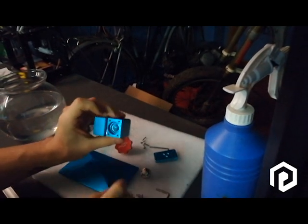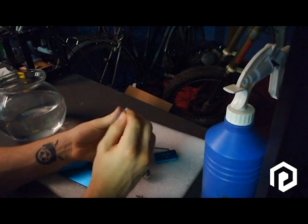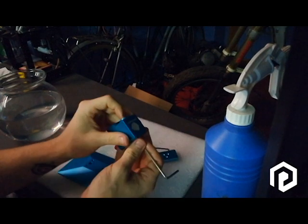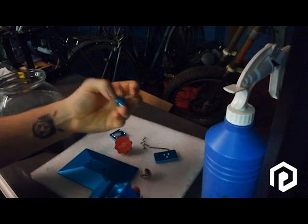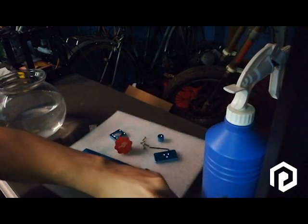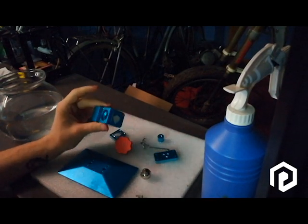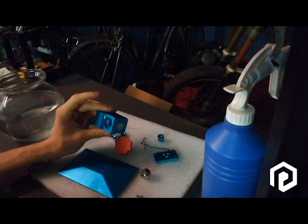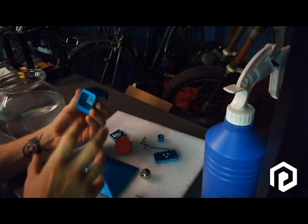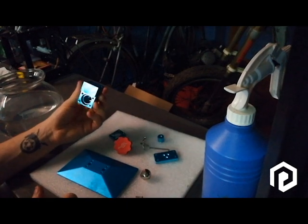So to take out this thing, you still have to unscrew one screw which is inside and quite difficult to see, so it will fall directly. And after that, you can clean everything with IPA and put everything back on the same base, in the same way as before.